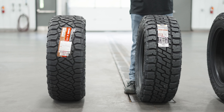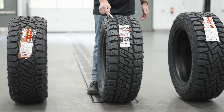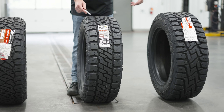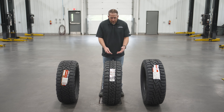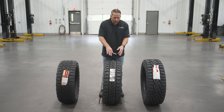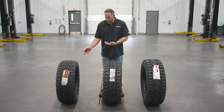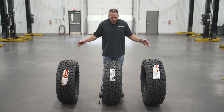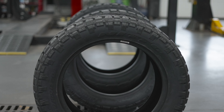None of these three tires has a lot of siping, but the siping is designed differently — it's full-depth squiggly-style sipes on the Nitto instead of straight-line sipes like on the other tires. You would probably see more Mickey Thompson Baja Legend EXPs on lifted Jeeps and lifted Ford Broncos, and more Toyo Open Country RTs on three-quarter-ton and one-ton single rear wheel trucks with lift kits. The Nitto Ridge Grappler kind of splits the difference.